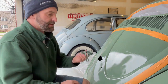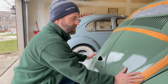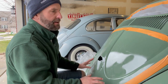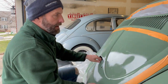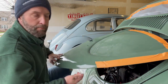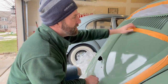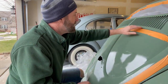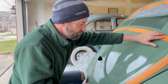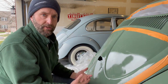And so what I've done is I've obviously taken the spring out here, and then I bolted everything up loosely, and I just kind of sat here and placed it, moved it around, and found a place where it looked correct. And then I would just open this up slightly, get up underneath here, and then tighten the bolts down. So right now, it's really good. There's a nice 1/4 inch gap here. I've taped all this off to protect the edges. Do that if you're doing this while you've got paint on it. And then I check the latch here, and that all mounts up correctly.